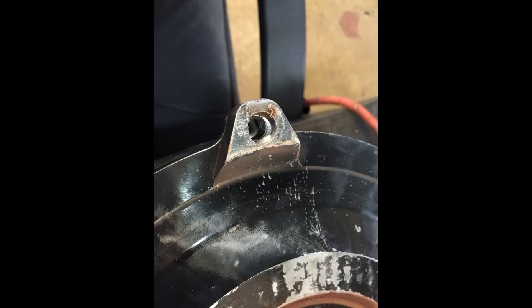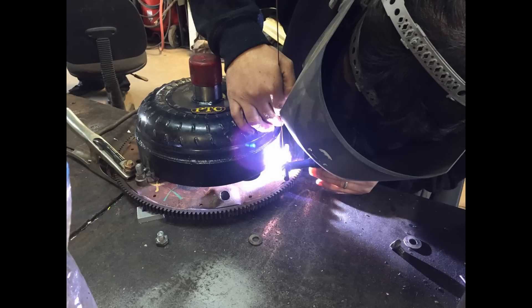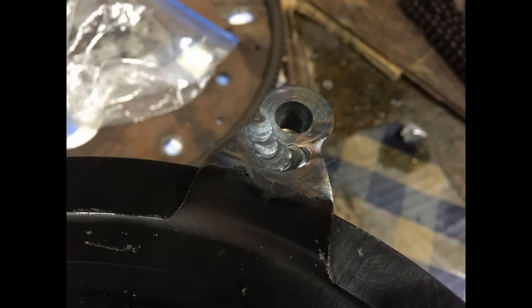On Saturday, all I needed to do was get my torque converter fixed. You could see the hole — I had a drill in it to get it together because all of the bolt holes stripped out. My buddy machined it out and welded some metal rings in there so I could put nuts and bolts through into the flywheel like a regular small block style. Harder to break, easier to replace.